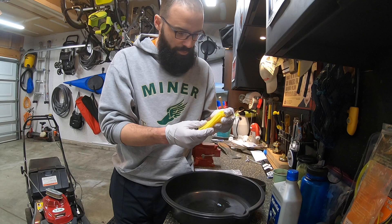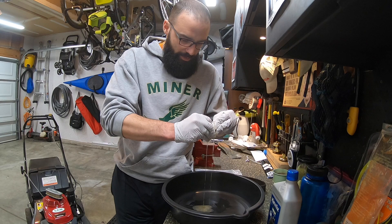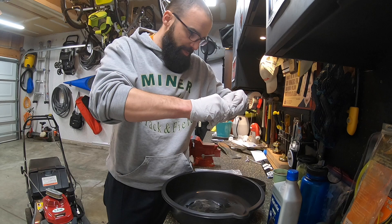It's pretty well soaked, so now all you do is just wring it out. You should see that oil drip out of the filter, and that's good — we don't want all that oil, we just want an oil residue on the foam element. Basically squeeze it until it doesn't drip out of the filter anymore.